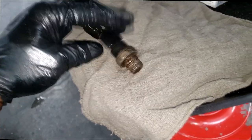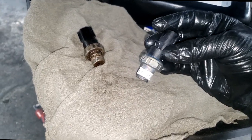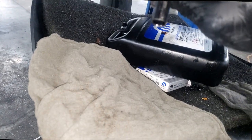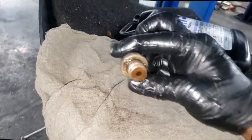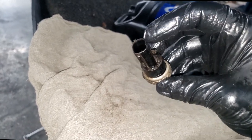Here's the old one. Because this is a 2006 engine, this is likely a 2006 oil sending unit. Here's my new one. You can't tell the difference by appearance, that's for sure. You can see where oil is even in here — probably if I turn that over, some oil trying to roll down. So if the pressure had to increase — remember, this is screwed into the block and reading oil pressure — if the sensor is coming apart inside, that oil is going to try to escape out by way of pressure pushing it out.